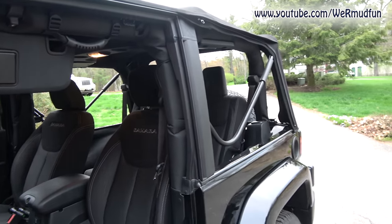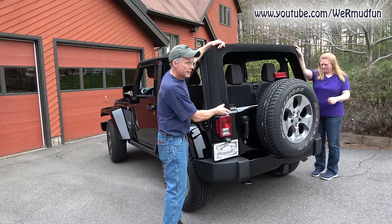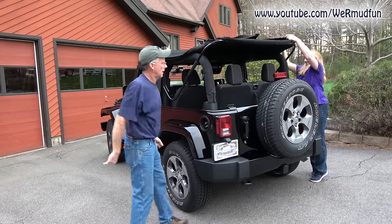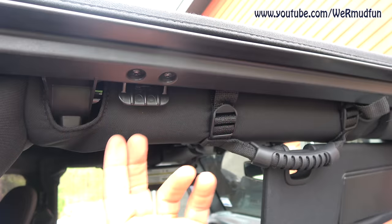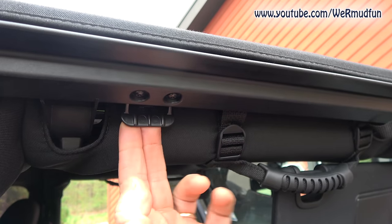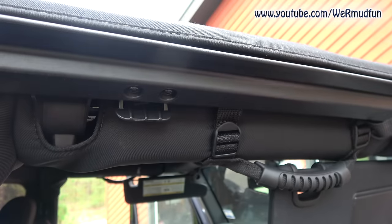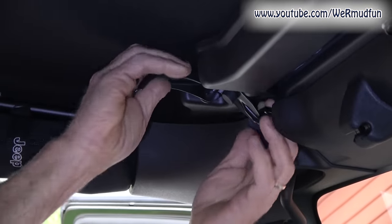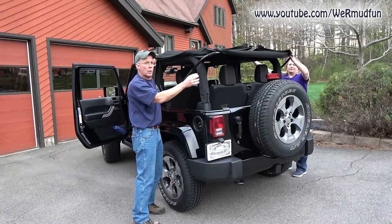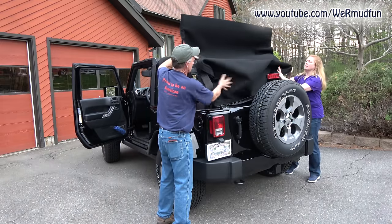Next step: pull down on the three bow and pull out the sail panels, then just roll them up on top. Next, release the side bow — this is the sun rider latch pedal. Pull it towards you. Then the last step — just release the latches. Then it's a simple matter of pulling the top down over the vehicle. Hold it a little and it comes down and looks decent.